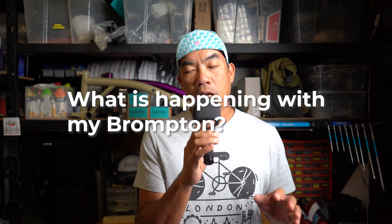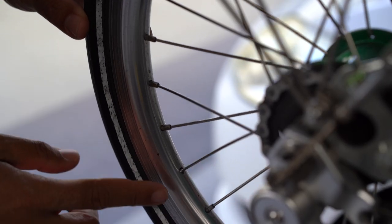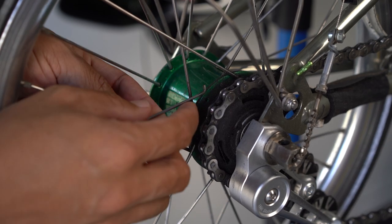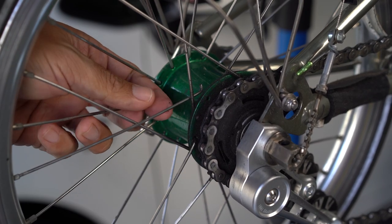So what happened with my Brompton? After careful inspection when I came home, I found there were two broken spokes at my rear wheel. One snapped off at the j-bend — the area where the spoke connects to the hub, which is usually the favorite spot for a spoke to snap. With that broken j-bend spoke, I could have easily unscrewed the spoke away from the nipple, but the nipple would drop into the rim and rattle when riding. So instead I had it tucked in with a little tension against the other spoke, so it would stay there until I could ride home and have it fixed.